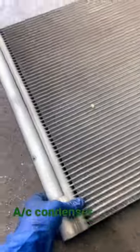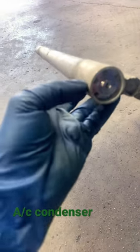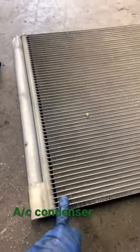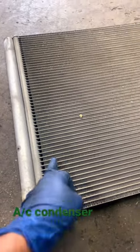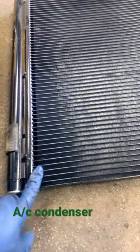There's only a screw here at the top and the line right here, over there, and down there. What's wrong with this old condenser — the original one — is the dryer is collapsed inside, so it doesn't have a good flow on this line. That's what's wrong. Now on to the new one.